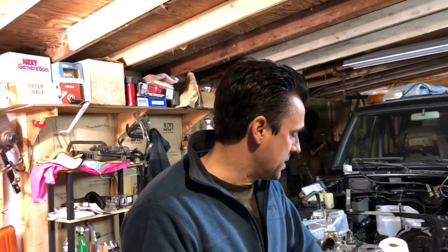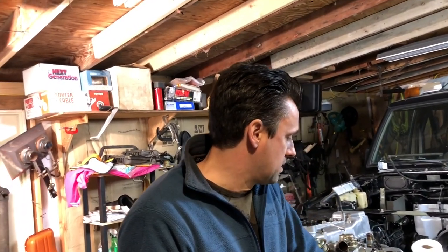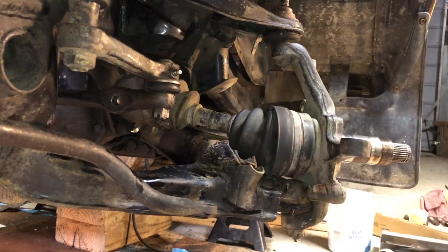I wrapped up the front suspension, which I was working on the last time I showed you what I was up to. Finished up the driver's side, got the sway bar linkage put on, and spent a little bit of time greasing zerts and replacing a few tie rod ends, that sort of thing. So I'm greasing all the zerts, all the suspension components here, before I put the shocks in and the brake parts back on. A little easier to get to some of these ball joints.